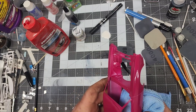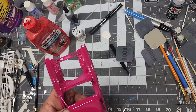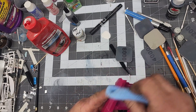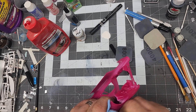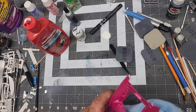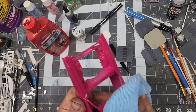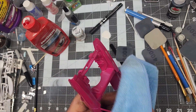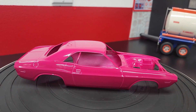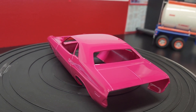So to recap: I started with 3200, worked my way to 3600, then 4000, then 8000, and then a little of the 12,000 without getting too carried away. I'm about an hour and a half into sanding and polishing. I know guys who spend way more hours doing this — sky's the limit. Let's put this on the turntable and see how she looks.